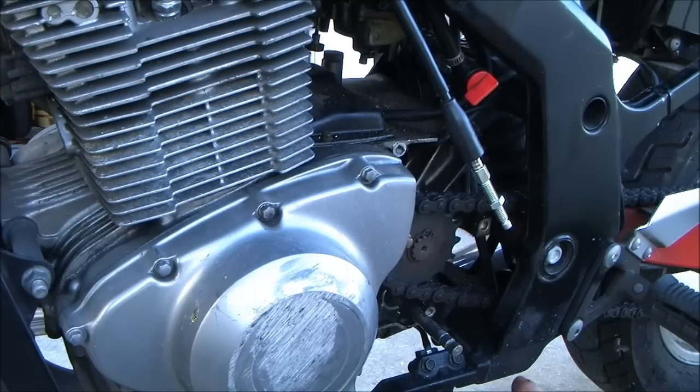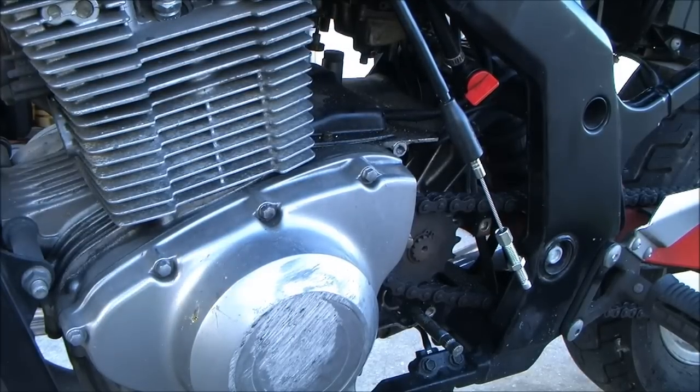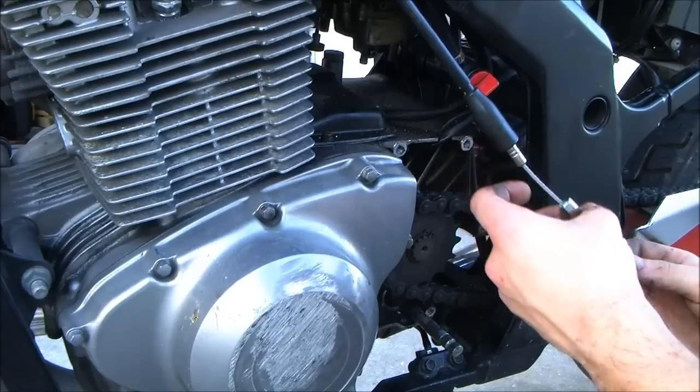Right here is the little thingy. Yeah, just twist those two wires together is all you do. I thought he already did that. Well, I don't know. I think if I hold my clutch in, I can start it, if the kickstand's down. No, there's no clutch safety switch up here. The hole's there, but there's no switch in it. Oh. Now we did the bottom? I know he took out your tip-over switch out of the back. He moved your whole fuse box.